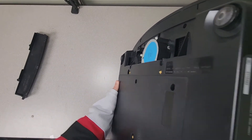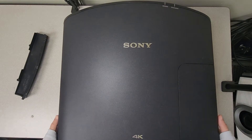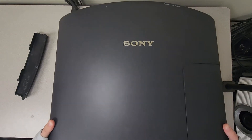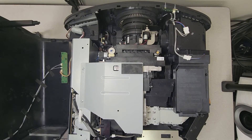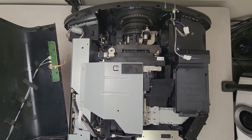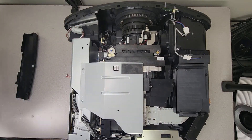Alright, let's get this flipped back over again - be a little careful because the cover is going to be loose now. It is basically willing to pop off at this point. To get this up, lift at the back, it'll come loose. It's clipped along the front right here - just pull towards you, that's all you've got to do. But keep in mind there's a cable right here that runs to your keypad. It's just a little wire with a notch on it - it unplugs with that little clip, comes off just like that.